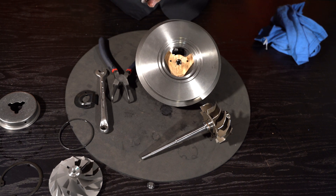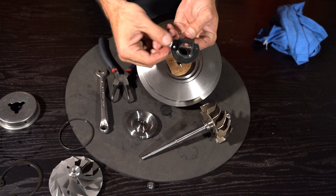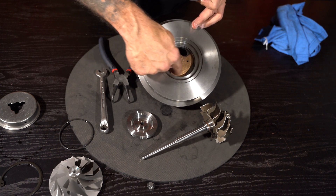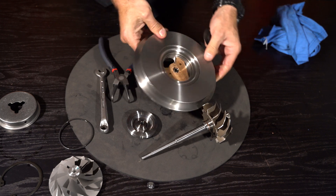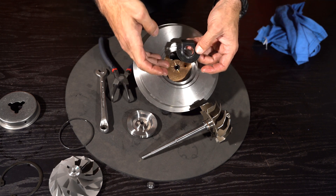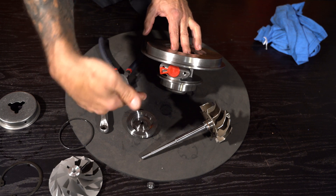The thrust collar fits into the insert — sometimes these are tricky to get in. Then you have your oil deflector. What this oil deflector does: as the oil feeds through the inlet, past the two journals, up and around the thrust assembly, it then needs to drain through what we call the pot belly — this area here — and then out the drain. In order to direct the oil straight out the drain so that you don't build up oil and have a bottleneck and eventual leak past the split rings, you put an oil deflector in, so the oil gets deflected via this plate straight out of your drain.